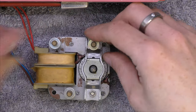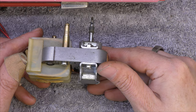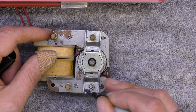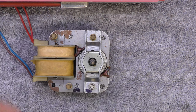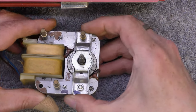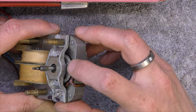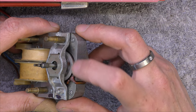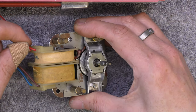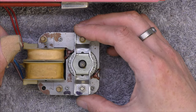Here's the motor itself. I'll just remove these washers before they fall off and get lost. Quite a small motor. What I normally do is put a mark on the motor so I can identify which way round it goes, just in case I forget - or take a photograph of it. Nothing spectacular about these. You've got these copper bits here which I believe cause a phase shift. That phase shift means you've got at least two poles, which then makes this rotor spin round under the influence of the magnetic field. The transformer just works as a normal transformer. These are the laminations basically. I'm just going to take the rotor out and give it a clean up and lubricate it.